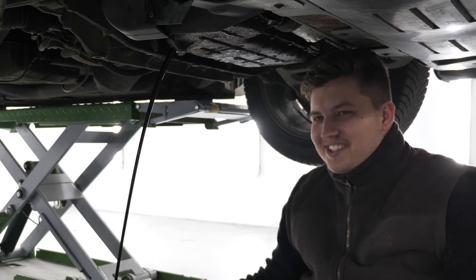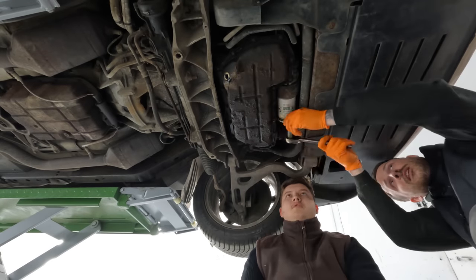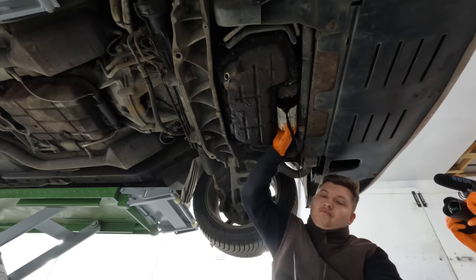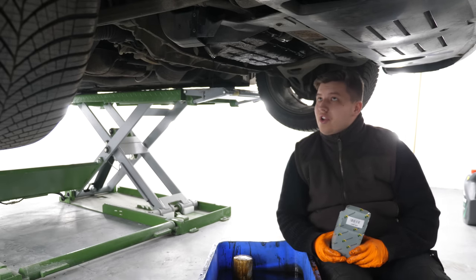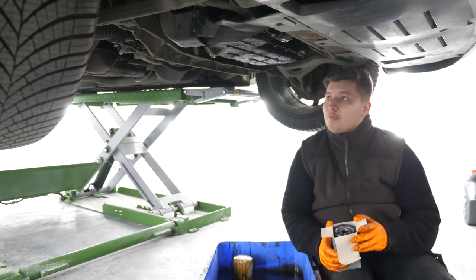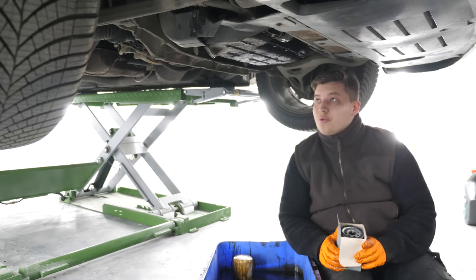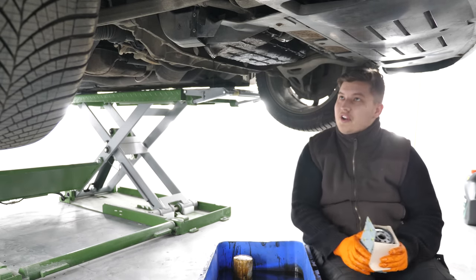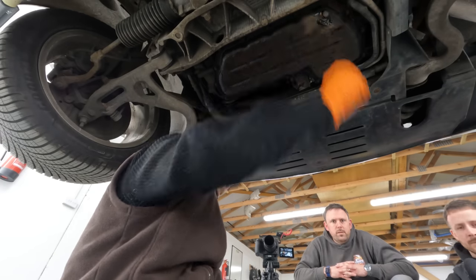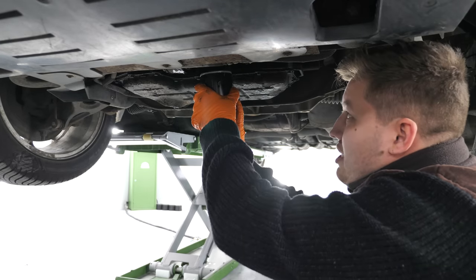It's so warm — it's like melted chocolate! Then I removed the oil filter, which was a little bit fiddly but came off okay. We'll let all of that drain for a little while, then I've got the new filter — that will go back in there, bung goes back on, and then we top it up from the engine bay. To most of you this is probably all obvious, but to me this is a very new experience and quite a satisfying one. I replaced the oil sump bung and added a little bit of oil to the new filter before putting it back on the car.